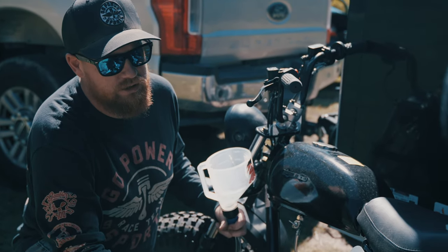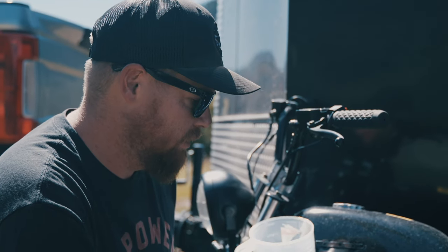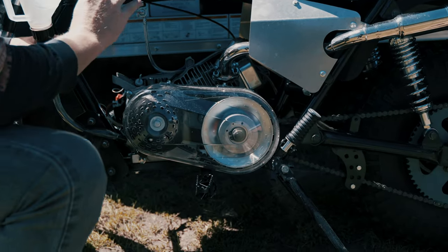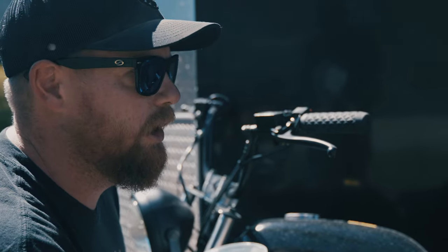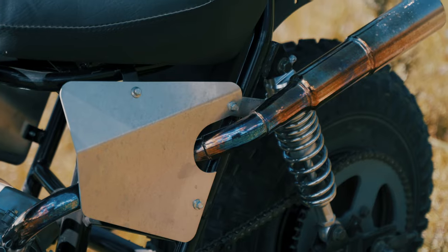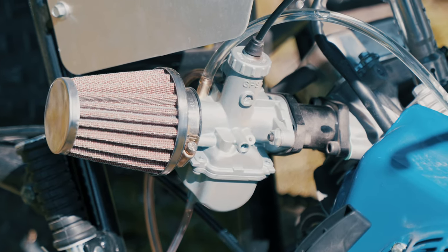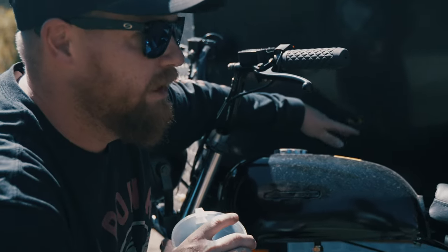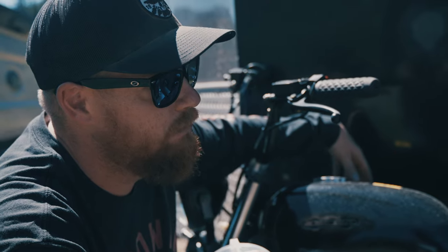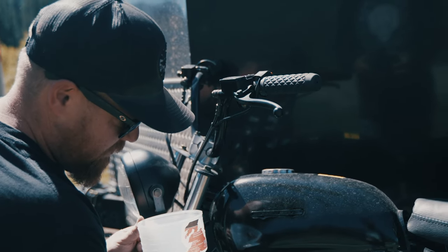Whenever you throw off the stock geometry of these bikes, you can start having chain problems, so the guide really helps. We have the Tillotson 212 engine — we took the MB200 flywheel and coils and swapped them over to the Tillotson block, did a Hot 265 cam, 22 Mikuni, and that gives us the RPM and power we need to run the Juggernaut. We also have the chrome super pipe, which looks awesome. The aftermarket VM22 slide carburetor is bolt-on performance, bolt-on horsepower gain, bolt-on RPM gain. They are jetted by us to our specifications, so they run really good right out of the box. Up here in altitude we might have to tune it down since the air is so thin, but we'll see. Another favorite is the bigger gas tank so we can be riding for hours and hours.